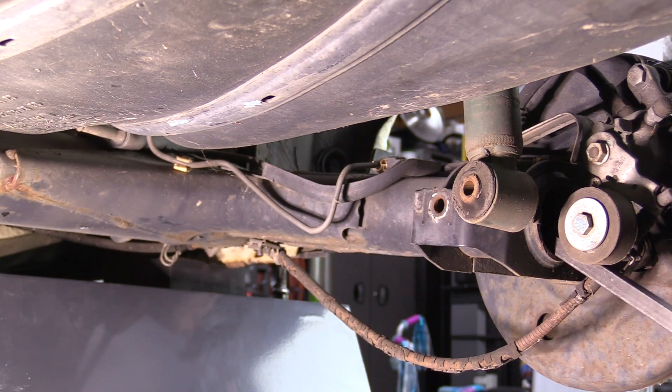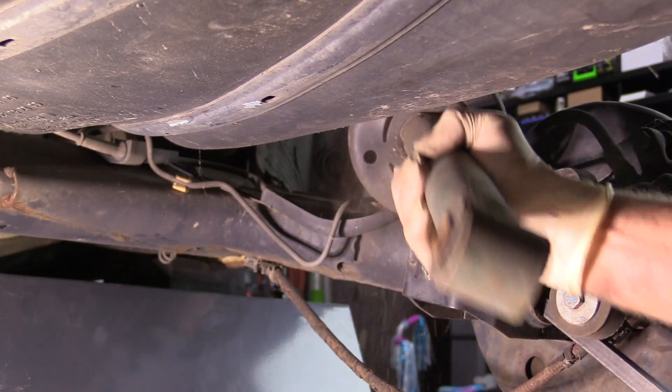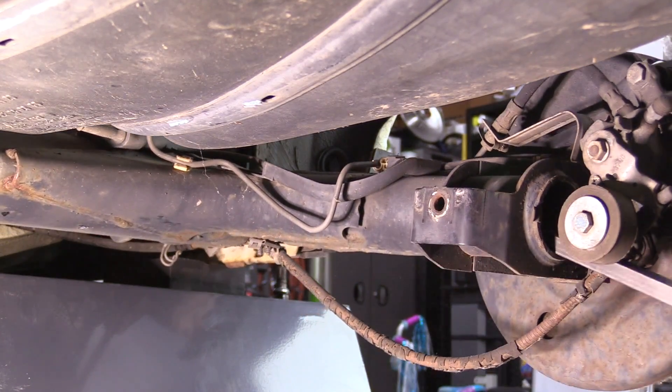Not only does this dramatically affect the way the vehicle steers, but it can impact how it brakes, how it accelerates, and how it takes a corner. If you're simply installing a lowering spring setup, this isn't really something you need to worry about because there is no change you can truly make to the suspension.